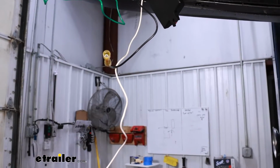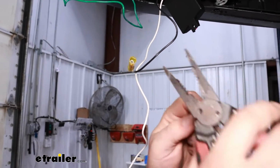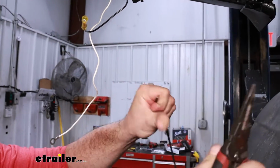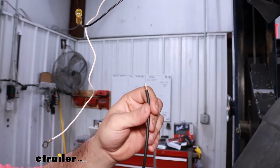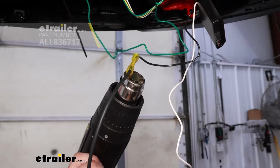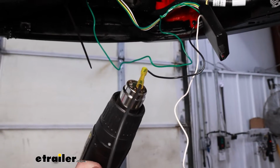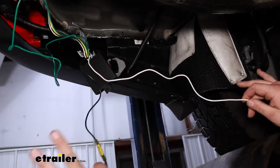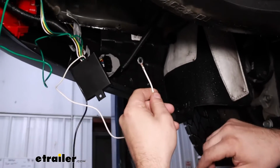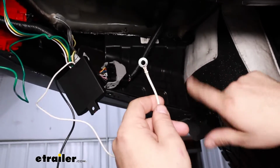Grab your spool of wire, and we're just going to strip back about 1/4 of an inch, and then we'll crimp this into our butt connector. Power wire you can leave just attached here. We're going to route that up to the battery, but we want to get our ground mounted up, and the ring terminal is already pre-attached.